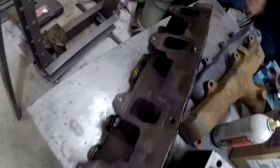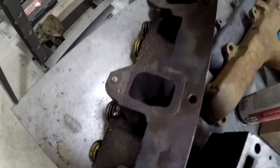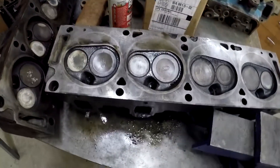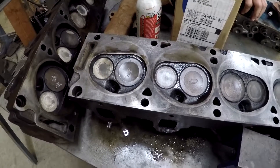You can see here the bolts that broke off - right there you can see the threads. We had a total of six break off. We could obviously drill those out and hopefully that goes well. Sometimes you've got to helicoil them.